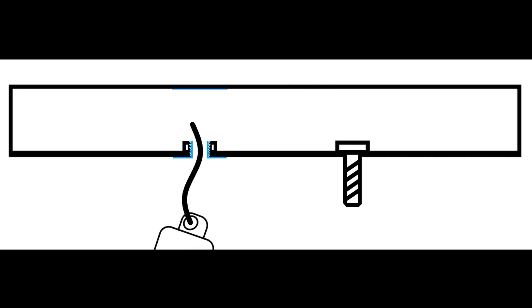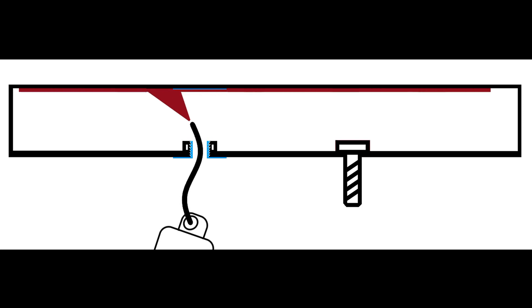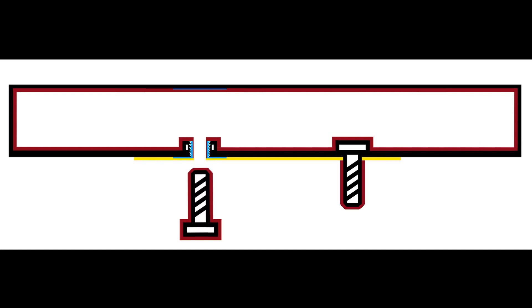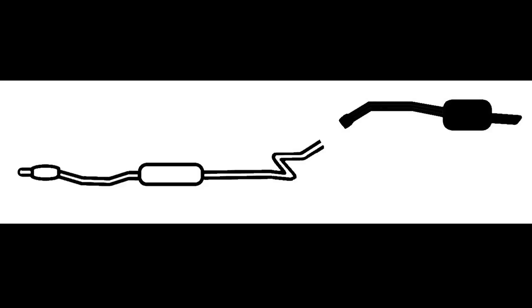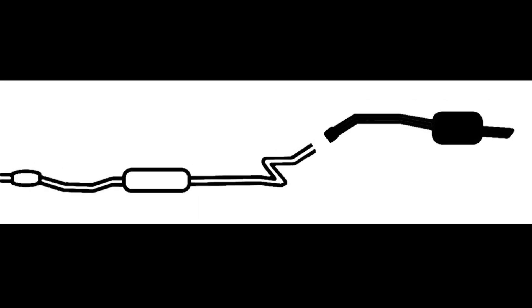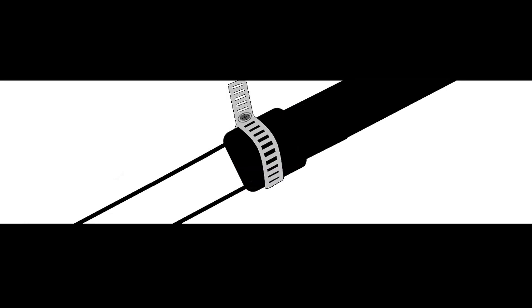Because of the broken bolt, the damper didn't fit snugly to the car's body. I was afraid it would deform under the exhaust weight and form a pocket which could hold water inside — it's just a matter of time before rust would spread in this area. I solved the problem by drilling a hole in the broken bolt's area and tapping a new thread. This area was covered with epoxy primer, the cavity was treated with liquid petroleum conservant, and the outer side of the car body was covered with bituminous mastic. The bolts were also covered with petroleum conservant.